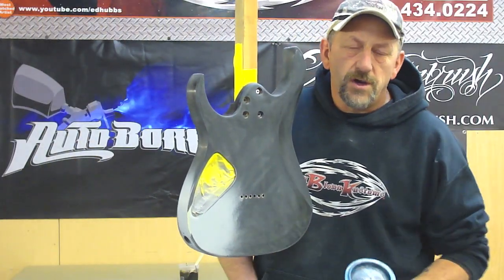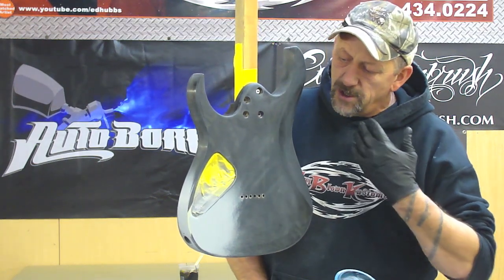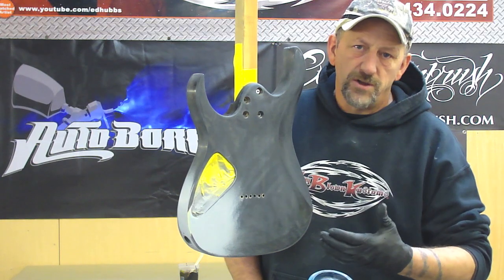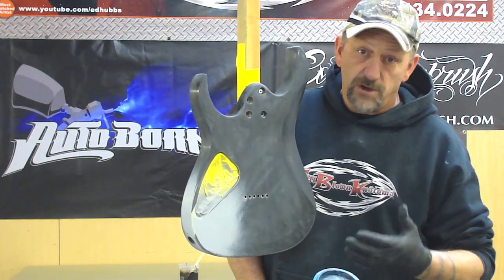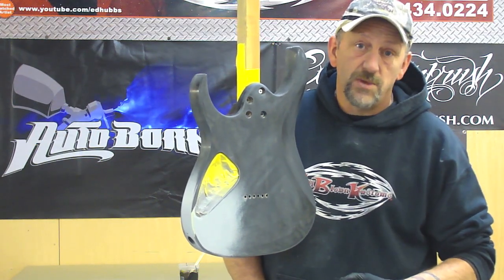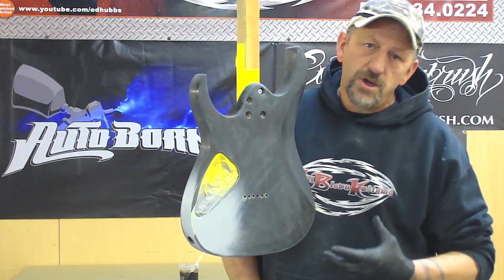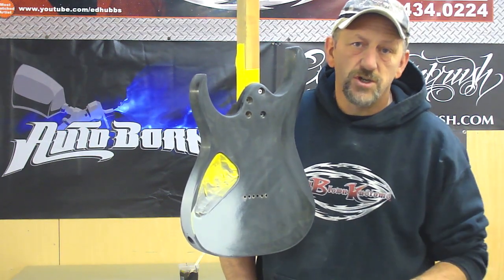I'm ready. I got my Iwata, it's all mixed up and ready to go. We're going to spray a nice, even, wet coat on. You don't want it so wet that it will run, especially if you don't have heat and airflow — it's different than spraying a urethane. I'll put a nice even coat across it, let it flash at least 10 minutes, then a second coat, same thing, then a third. With good airflow and heat, five minutes and you're good to go, but it varies in your shop.